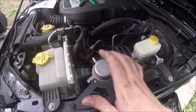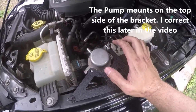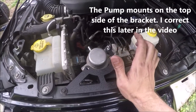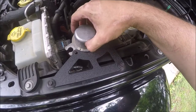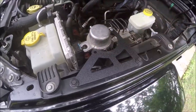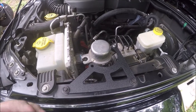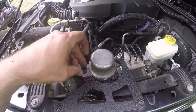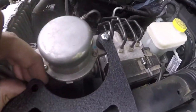I have run into a problem. I'm going to go ahead and mount this pump, and I am running into a problem because I'm missing that other isolator that was cut off this Jeep prior to me owning it. I don't have one and I'm going to have to order one. This obviously isn't going to bolt up properly the way it's designed for that isolator. So what I did was cut off a section of the original vacuum hose to put on the top as an isolator.